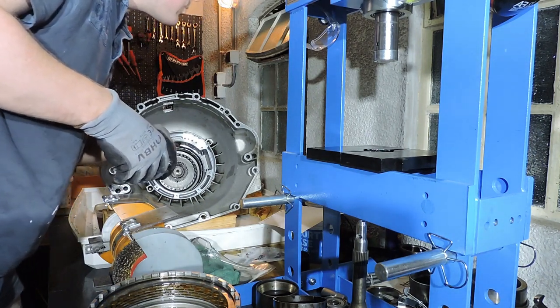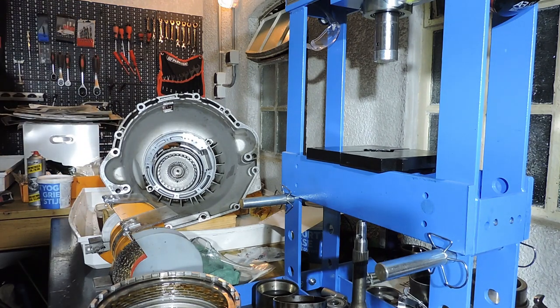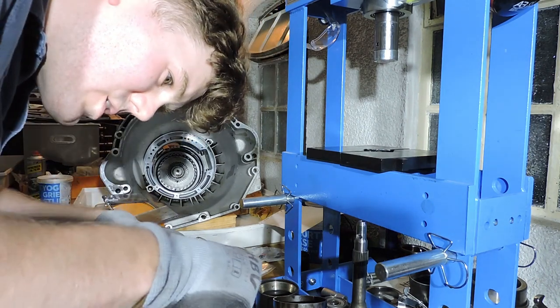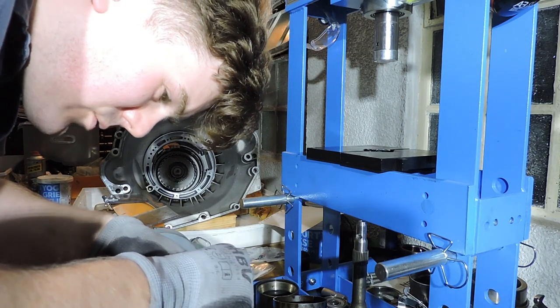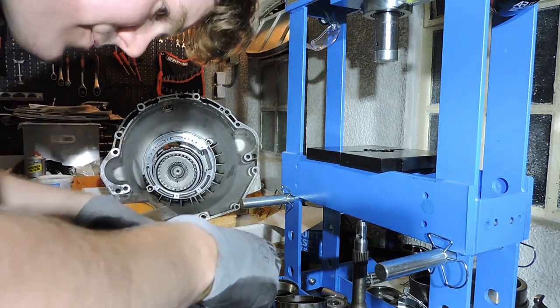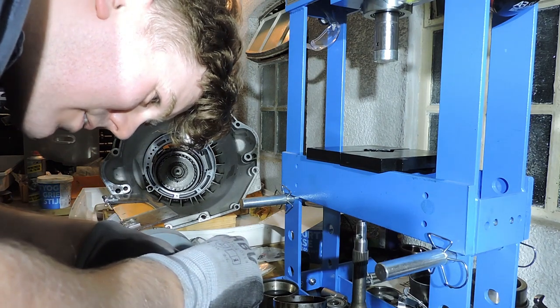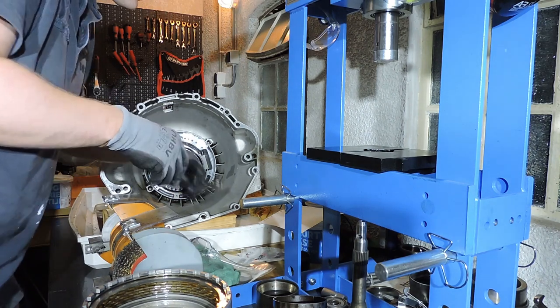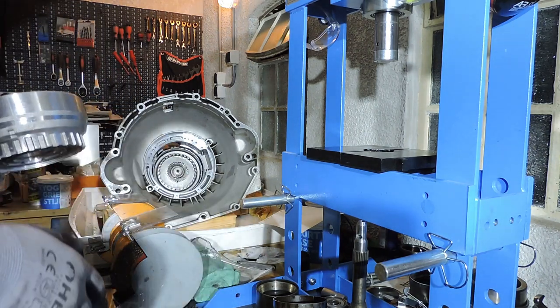And the lower limit was 165. I should still be able to get 165 in. I'll manage. I'm going to put 8 and 8.5. This is 165. I should be able to put 165 in. And on this side I can. 165 fits. And on this side also. So that's okay. End play is correct. This one's ready.